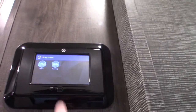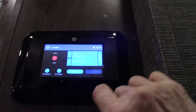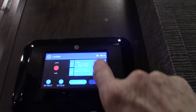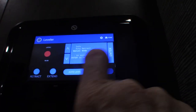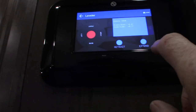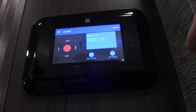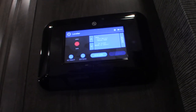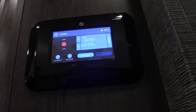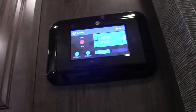This is your touch panel — it's just for leveling. I told you about auto level and auto hitch. You can scroll through the options. If you want to go to manual mode, you hit enter. Then you can extend and retract by selecting front, rear, left, or right — you can operate the jacks independently of each other. Also, if you have to abort because something's going wrong or something's caught underneath, an abort button will appear once you're auto leveling. Just hit it and it'll kill it immediately.